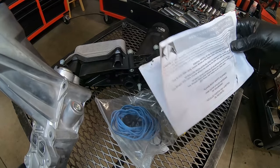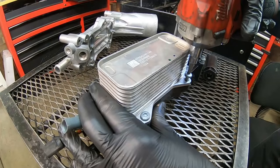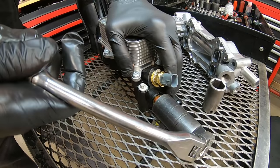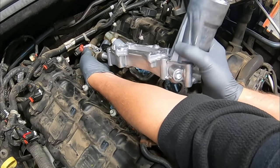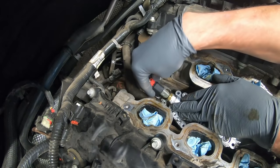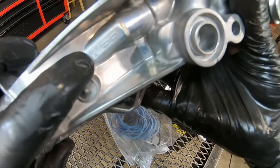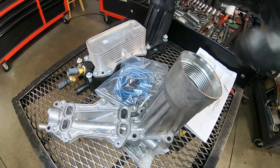It comes with all the instructions, including torque specs for all the fasteners for the cooler, because you will be swapping your old cooler over to the new housing — it does not come with a cooler. Also, your old oil temp sensor and old pressure sensor, you will be reusing those. So make sure when you take them off, you put some thread sealant on them and reinstall. There are torque specs in the instructions showing you step by step what you need to do. One other thing — look real close right here — it says made in the USA. Hopefully that stands for something; hopefully it means quality and something that's going to last.